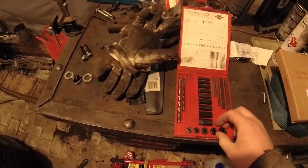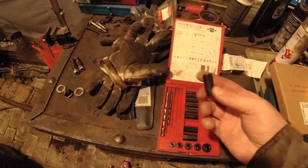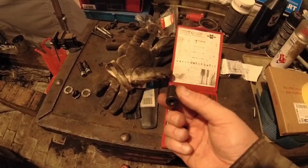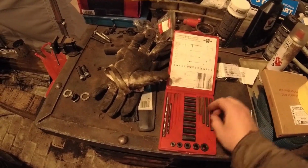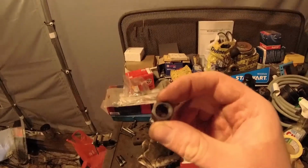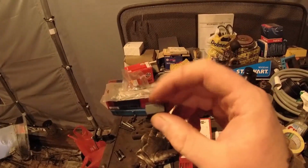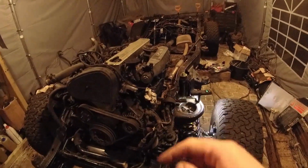Basically, it's pretty simple. These are the right width, the right diameter for the screw that's broken. You stick this in there, I guess like this, and then use the drill, just so this centers the drill. And when that's done, you take the appropriate, I don't know if the camera will catch it, it has like these rails on the sides. Just beat this in with a hammer and put on this cap for it that also has dents on the sides, and then try to screw out with the tool. Yeah, we'll see how that will go. But for now, time to take that off again.